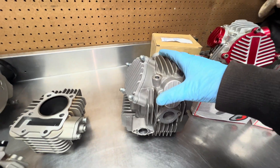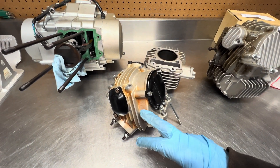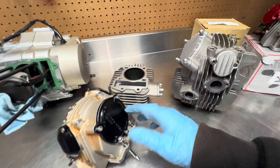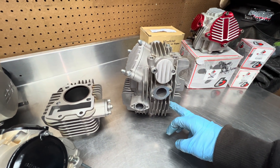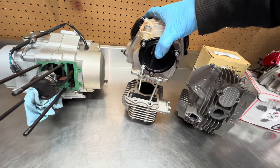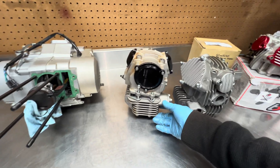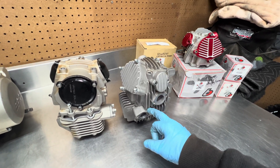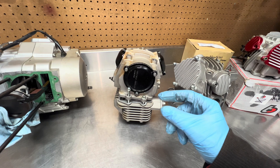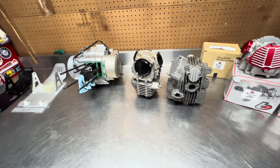But if I went with this setup, this right here is a 60 millimeter piston, so if I use this top end on the 53 millimeter bottom end that would make it a 150. I could probably do this head on this 60 millimeter cylinder. The only thing is these cylinders are a little bit different height, so when you use this head on the KLX style cylinder you have to use a shorter timing chain. My blue Slow Racer with the YX 180 build is a 56 millimeter crank; most YX engines like the 160 will have a 57 millimeter crank. When I put the V2 head with the TB parts 64 millimeter bore kit on the 170cc motor with the 56 millimeter crank, I had to use one link longer on the timing chain — I believe it was a 92 link versus the 90 which comes on the 160.